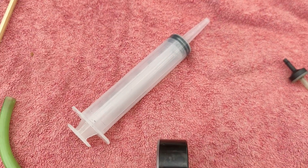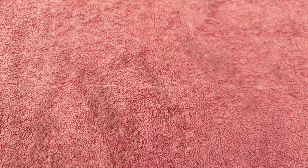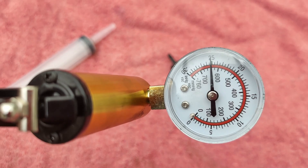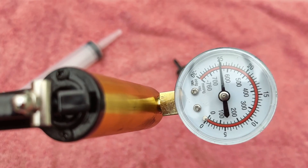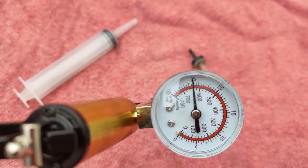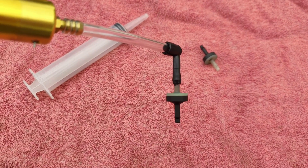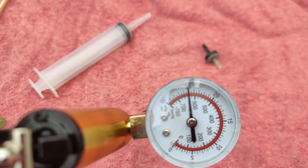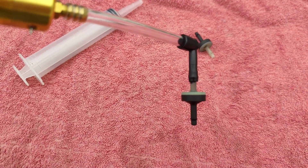Slight footnote: I just used an old syringe to pump some soapy water through this valve, and it's now holding a vacuum. Would I trust it? No. Could I have done that as an emergency repair by the roadside? Absolutely. Just by pumping a bit of water through it, I've obviously flushed out whatever bit of grit or filth was causing it to jam. But yeah, that's now holding a vacuum — still going in the bin though. Interesting experiment. Thanks for watching.